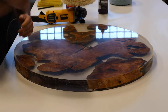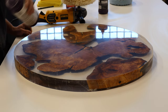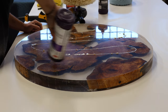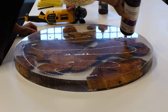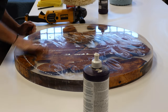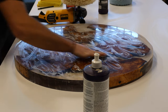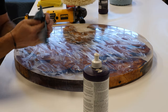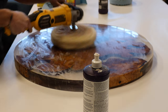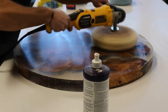First step — wool pad. Shake it up really good. This is a small enough area so we're gonna do the whole thing at once. Remember, a little goes a long way. You can apply it one of two ways — I like to use my fingers to kind of spread it around. You're probably gonna have to do this first step a couple of times. Take your buffer, help spread it out, and start on a low speed.